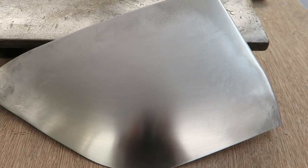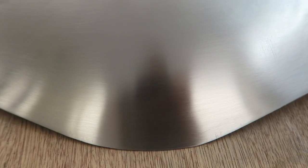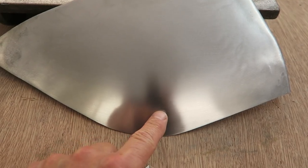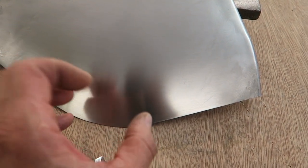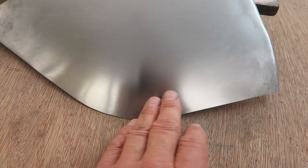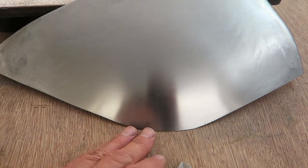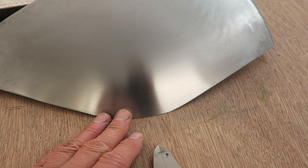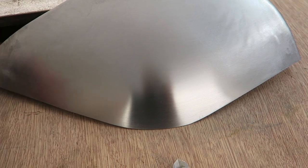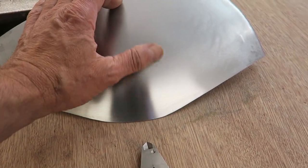For the people that wanted to know about removing the shrinking marks - because that deep-throat shrinker leaves some pretty bad marks - can they be removed? Hopefully this answers your question. And for the people that are going to say I've removed a lot of material from the outside edge: very true. Don't forget, we've shrank it down, so this will have increased in thickness after it's been shrunk. I've removed quite a bit of surface steel to remove the marks and polish it up. I've said many times it's pointless to relentlessly polish a piece of metal you're going to paint. Modern fillers don't shrink like they used to, and modern paint products are pretty good at hiding a multitude of sins.